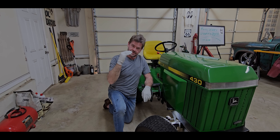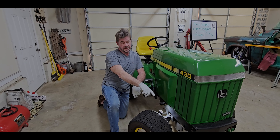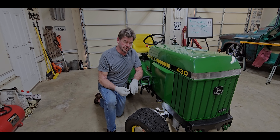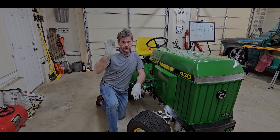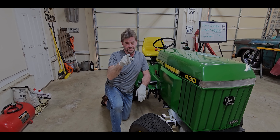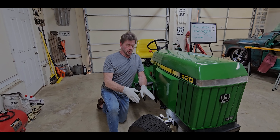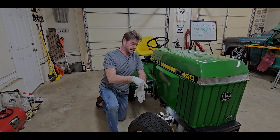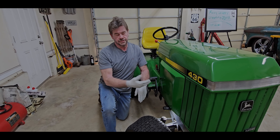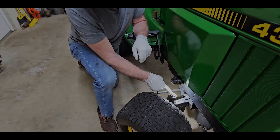If you have a lot of clearance, go ahead and pull your axle out. You'll have to pull the front PTO — it's kind of a job because the shaft goes through the front axle — but you can get the replacement parts, and I'll show you the exploded view on Steiner. Also, I want to correct myself: I said there was a grease fitting — there is not, so sorry about that. Now if your pivot is good, or you've fixed it and put a new bushing in, the next step is we're going to talk about the rub blocks and the adjustment for that.